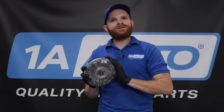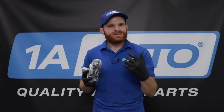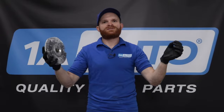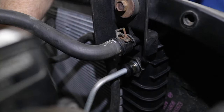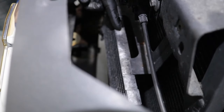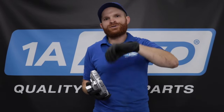Something that's important to remember about your fan clutch is of course the fan attached to it is going to draw air through that radiator and cool down your engine and cooling system. Your transmission also needs to be cooled as well. Usually inside of your radiator, you're going to have a separate cooling system for the transmission that runs through there. If you don't have the system that runs to the radiator, you're probably going to have an external cooler located in front of the radiator. If air isn't flowing through that cooler, you could potentially cause damage to either your engine or your transmission.